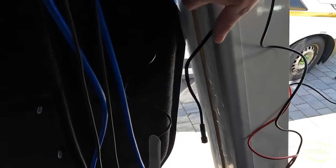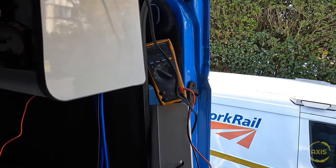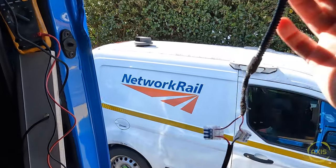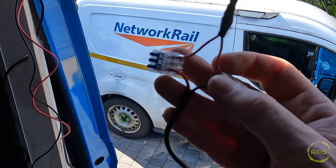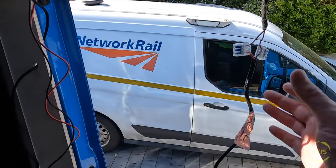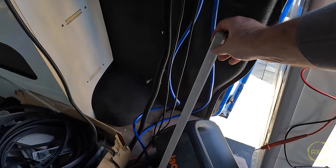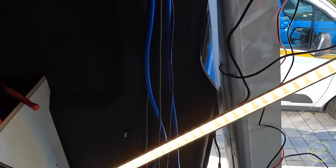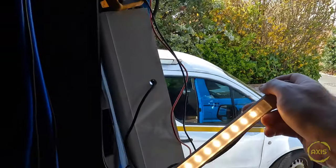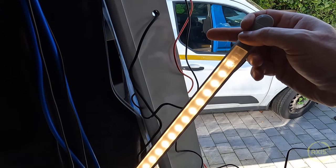Cables are tidy now. This is going to have an LED in the front here. I've used the factory wiring for the door light - the ceiling light that comes on when you open the doors. I've wired this up now - green and red, purple and red into negative there. Just checked the minus and plus, it works. All I've done is wired it up to this LED section here - that should come on with the door. It's a dimmable one as well. It's ideal because it's right above the door. When that goes into the cable unit above, it'll come on when the door's open, but you can also turn it off inside if you need to. It's touch sensitive and you can dim it as well - just hold your finger on it.